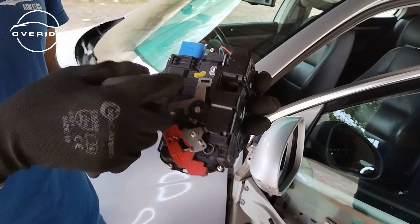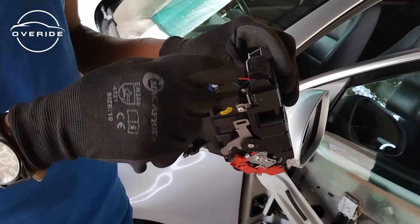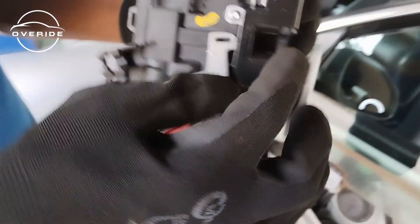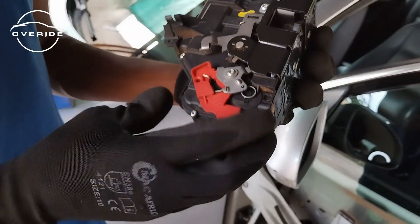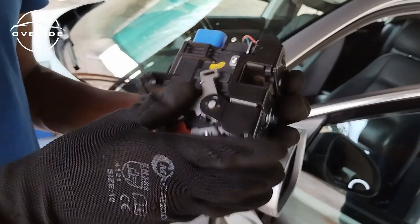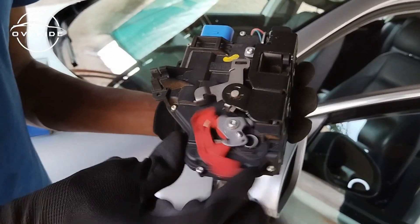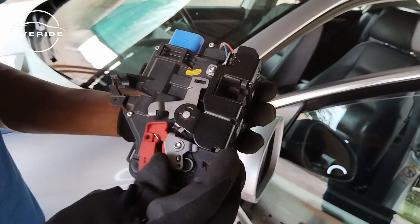You can use several methods to check whether it has failed. If you look at these power lines, you can supply power directly onto these cables — and if it does not move, you know the door lock actuator has failed. It cannot move even when I'm supplying power manually, which confirms it has actually failed.